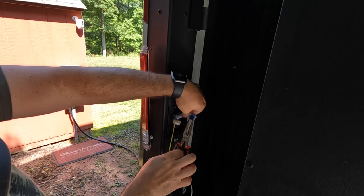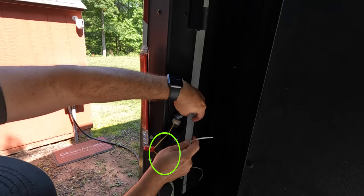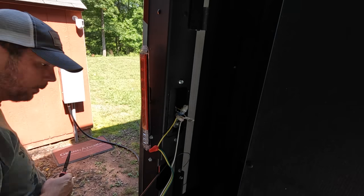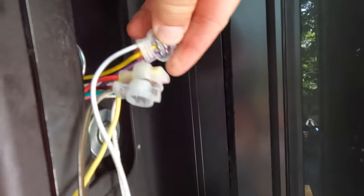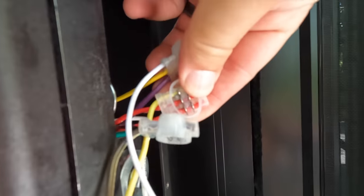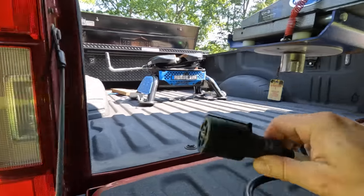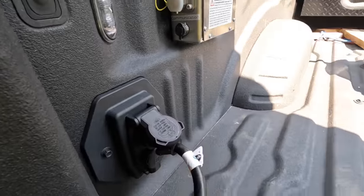Armed with this information, I got the light bar wired in directly. For this test, I just used a wire nut to combine the left and right turn signals from the wiring harness. This is just temporary for testing to see if I need the module adapter or not. I also used the existing three-wire crimps that were there since they had an extra lead in them — I just pulled the old ones out, added the new one in, and crimped them back down. Again, this is strictly temporary. I will put brand new connectors on this when we wire it in permanently.